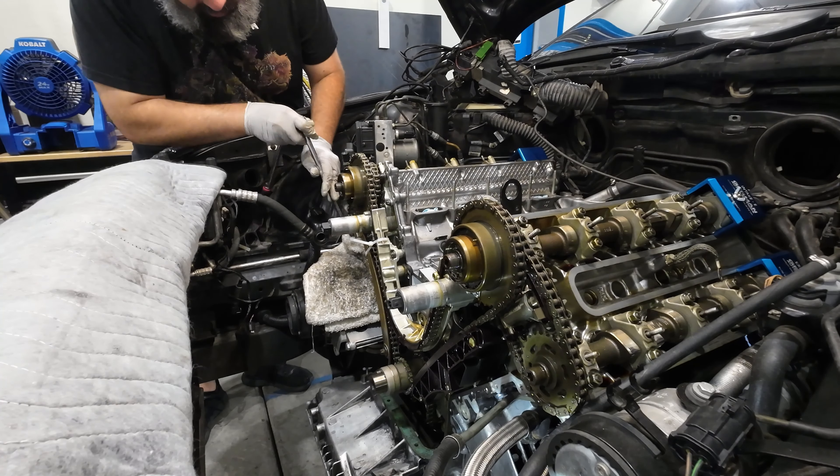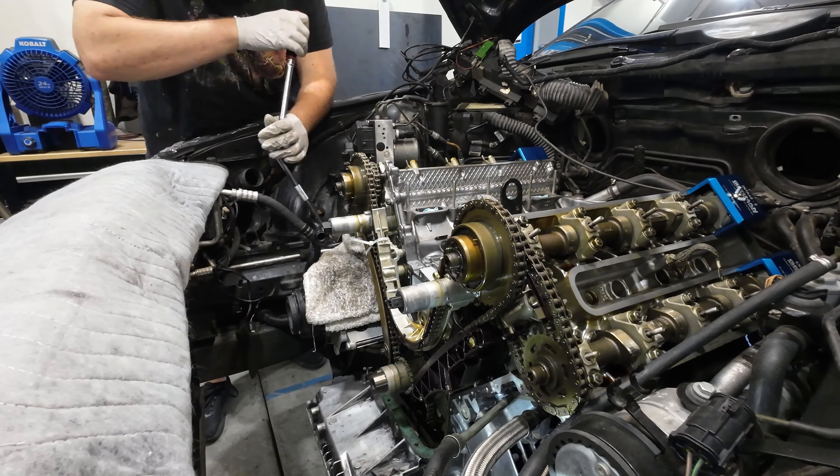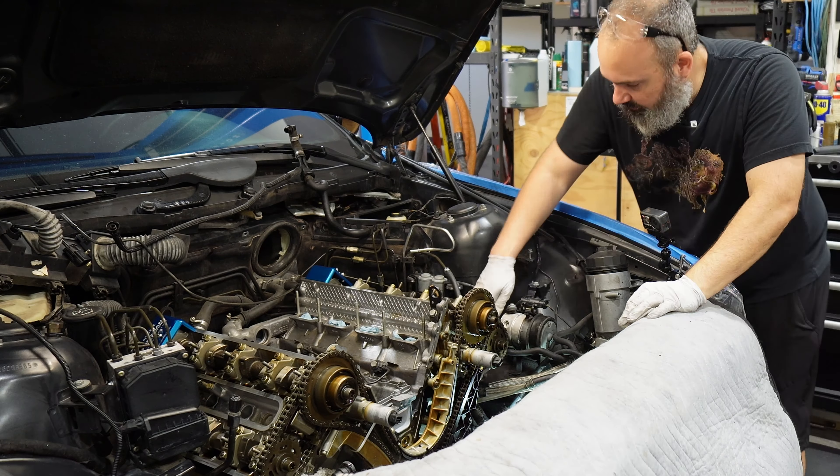I'm just going to break them free and get them from the bottom so I don't have to try to sneak them out the top. Now while we're at it, let's get our power steering lines off and out of the way. We need to start by removing this line first — that's the back bolt — that'll give us better access to our front bolt, which will be much easier to get to once we drop the subframe. I forgot a pretty important step: before you go and lower the subframe you've got to support the engine somehow.